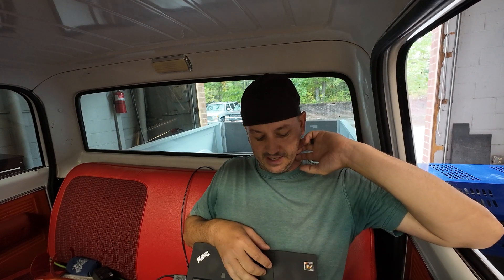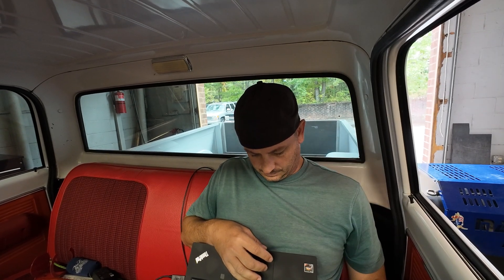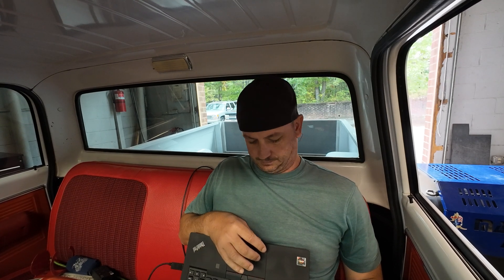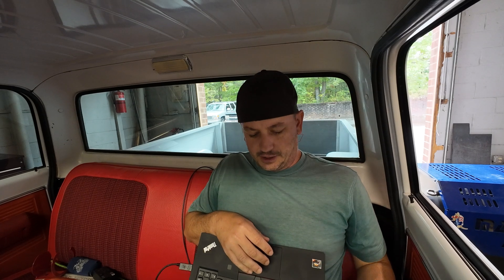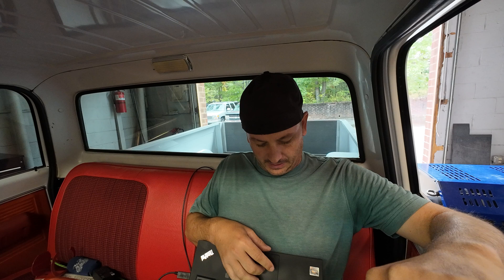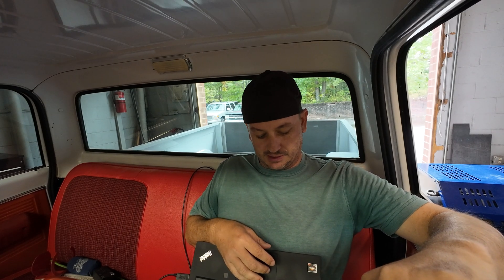I have the learn table turned off and I'm just going to manually adjust the fuel table as needed. It's actually fairly close already. I just kind of rolled it a bit to see if it was in the ballpark. I don't like trying to get too precise with the changes until I verify that it's not out in left field. But I think this is close enough to work with. It looks like right off of idle it's going to need the most work. So I'm going to go ahead and work with this and then we'll come back once we start getting ready to do some full throttle stuff.